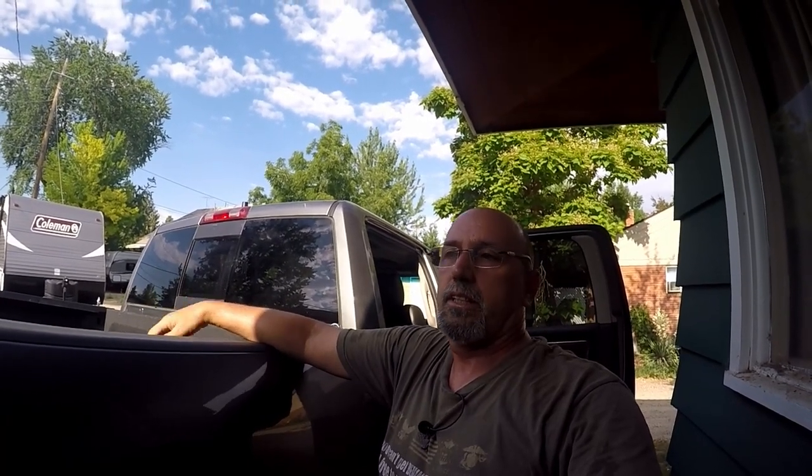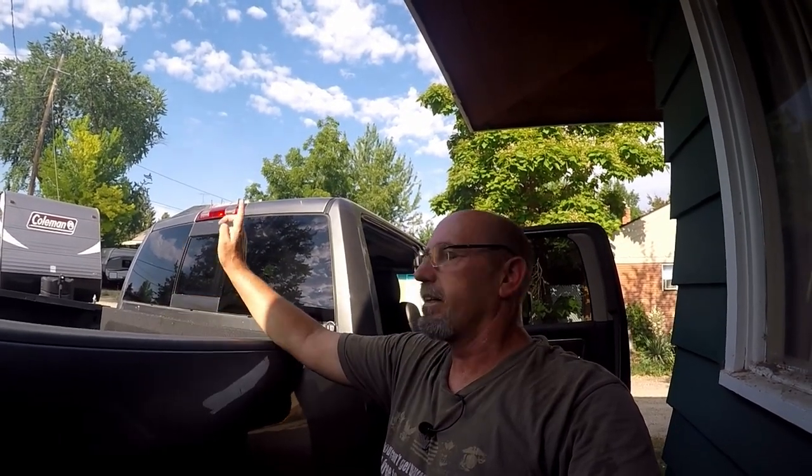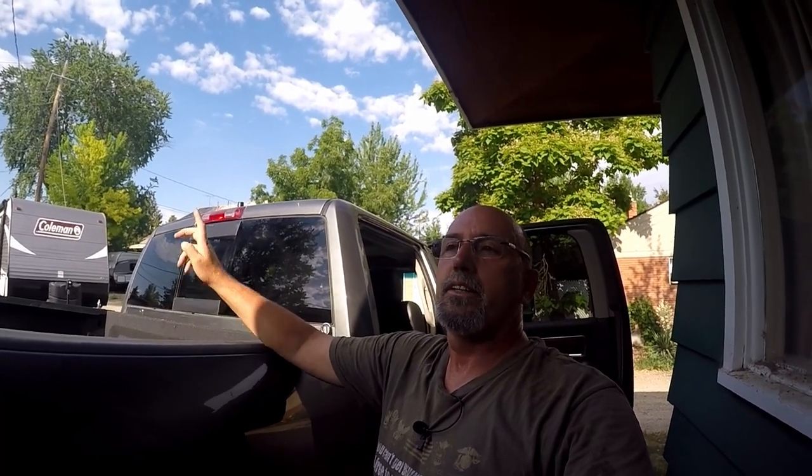Finish letting her dry and then I've got to come back and do some cleaning. The tip: don't use hot glue as a seal or to watertight anything. And if you have one of these trucks, be a good idea to get up there and double check. Mine had silicone and I can just take a little utility knife, scribe it, and pull it off. I'm not gonna replace that little foam that comes with it — silicone will be a little bit better protected. Anyways, if you guys got something out of this video, if you liked it, please hit the like button, subscribe, and share, and until the next repair, happy camping.